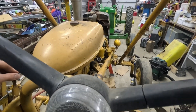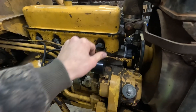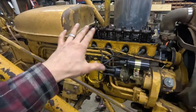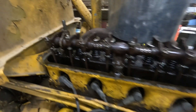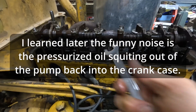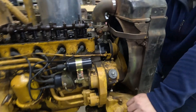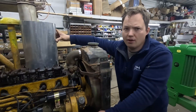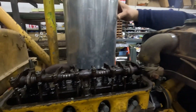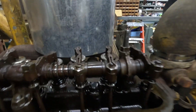Good oil pressure. I just did a re-torque on the head bolts because I feel suspicious it could start leaking. We heard a funny noise too. Just making sure the cam is in good shape. We wanted to see where the oil comes out — we're curious how these get oiled all throughout. I had put oil on them previously, but oil obviously gets up in here somehow. So we're going to run it for a moment without the valve cover to see.